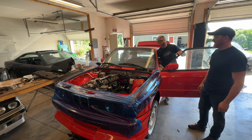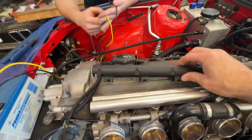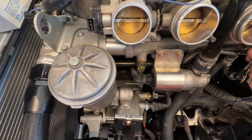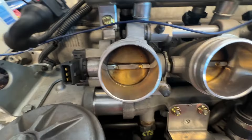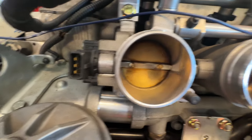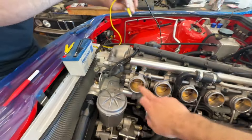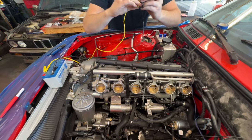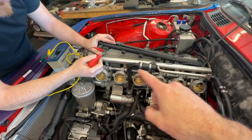So you don't have idle throttle control from the crank position. I'm going to pressurize the fuel rail. Dan, would you actuate one of those injectors? Put the power and ground to that injector and you should hear a little something when you do. Did you hear that? That was the injector actually. See if you can do more — listen carefully. Yeah, you just relieved the pressure of the fuel rail with the first one, so the rest aren't really going to let much fuel through. But we'll just verify they're working — they do actually work when we put 12 volts to them.